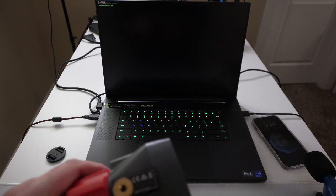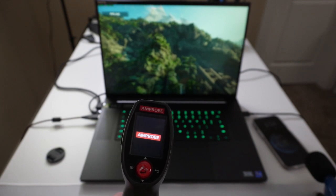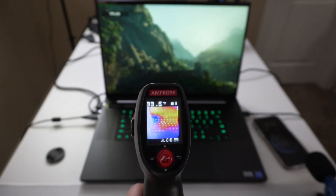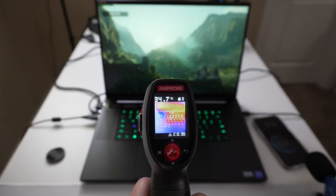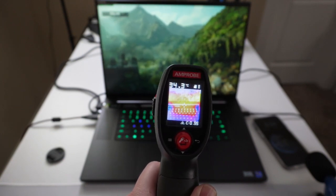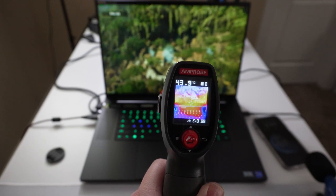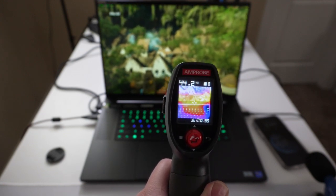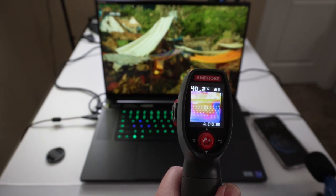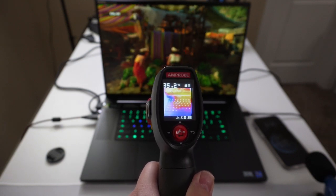Let's check out the temp of the laptop. I was reminded in my comment section on another laptop review that I didn't go over the WASD keys for gamers — that was a huge miss for me. Right now we're looking at around 33 to 34°C over the WASD keys. It gets hot around 42°C right between the screen and the keyboard where the fans are. Over the GPU and CPU, we're looking at around 40 to 41°C, and back over at WASD, 34 to 35°C.